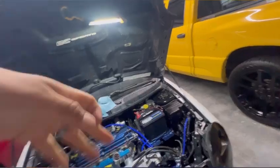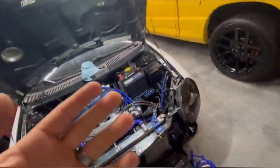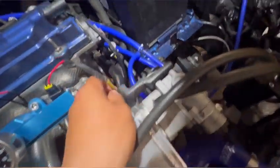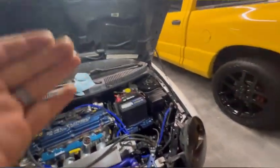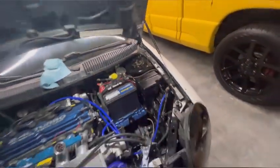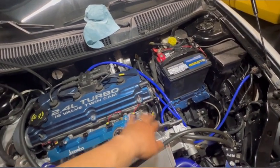The car did start. I did work ahead and didn't film, but we spliced in the connectors for the injectors. I'm going to tell you what I did and how I did it, because there aren't many accurate videos on how to splice in the connectors. This harness — all the connectors have a green wire. I used a test light: I thought there was a positive and a negative, but it turns out they're all negative according to my test light.